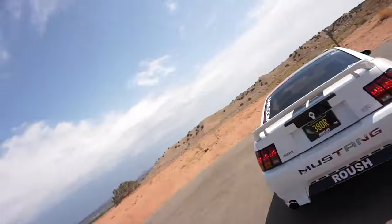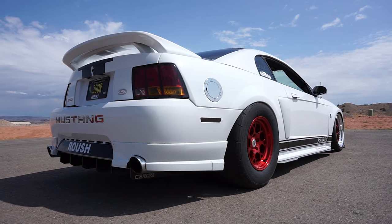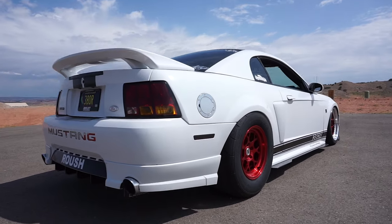I'm going to have my brother do a startup for you. Exhaust-wise, it's got BBK equal length headers, BBK catless X-pipe matched with the Flowmaster cat-back. I did take off the Super 44 mufflers and replaced them with Super 10s. So it's loud. As you can see, it's not obnoxiously loud like straight-piped SLPs, but it's got a really loud, deep rumble to it. It does drone quite a bit on the freeway, not going to lie.